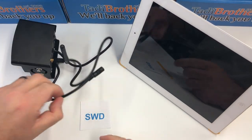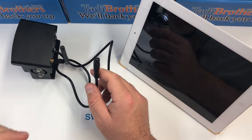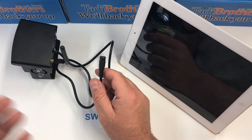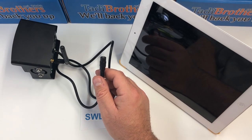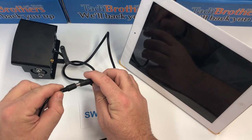The next stage is connecting the camera to some kind of 12 volts. If you want it on all the time you have to connect it to a constant power source such as a running light. If you want it on only when you go in reverse, you have to find a power source that turns on in reverse, like a reverse light. For this demonstration I already have power set up, so I'm just going to plug this in like this.